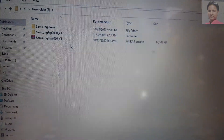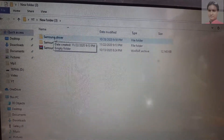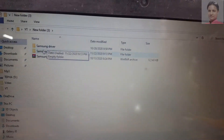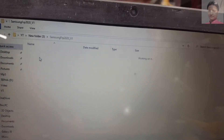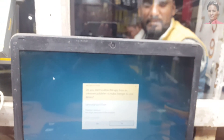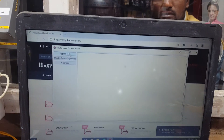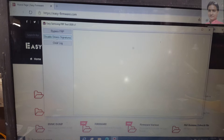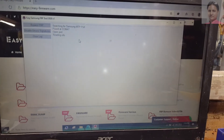Open this tool — Samsung FRP. First of all, install the Samsung driver and launch the tool. Now open the tool. First of all, disable driver signature enforcement: click here and restart your PC, then click FRP bypass or bypass FRP.